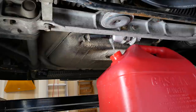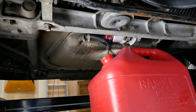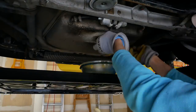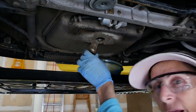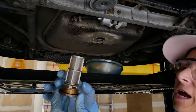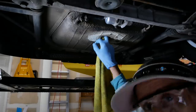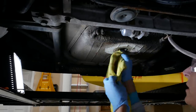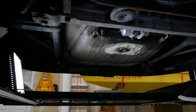Once we bought the car I cleaned it all out - the screen was even broken, snapped off the plug, so there was no filtration going into the pump. The pump was fairly unhappy about that - screaming really bad. When these pumps get hot and can't flow properly they get super noisy, and most people just replace the pump, which I did as well. While doing that I double-checked the tank, found a mess, replaced the plug with one that has the actual screen, replaced the fuel filter, replaced the pump. It's been great since then. I think the tank is going to be okay-ish for now.